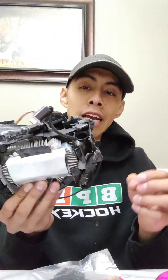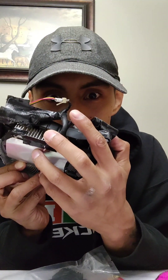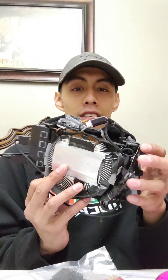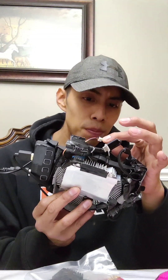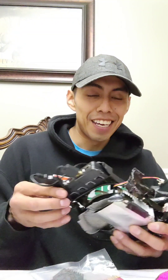So I finally got out my Amazon stuff. The last video I talked about how I got the ROG Ally and I attached a lot of things to it with duct tape — USB ports, a one terabyte drive, and a hub thing that powers everything. I had to rework that to get the fans working because the fans have three pins and the connector is only two pins, so I had to figure out which ones power it on.